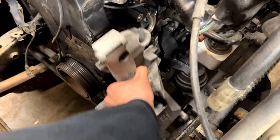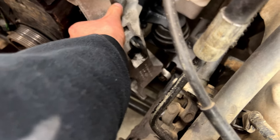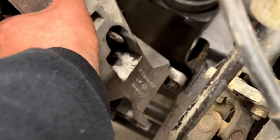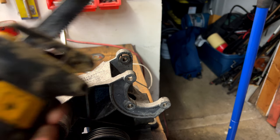So it mounts to the block like this — if you notice, it's hitting at that very bottom casting down there, the one with that metal sleeve in it. I think if we just lop that off it should fit right in there. This seems a bit destructive but we're not even using this Volkswagen steering pump so I'm not too worried about it. I really like this accessory bracket and want to keep it with the TDI, so I'm fine cutting it up. Always a good time when I get to use the Sawzall.